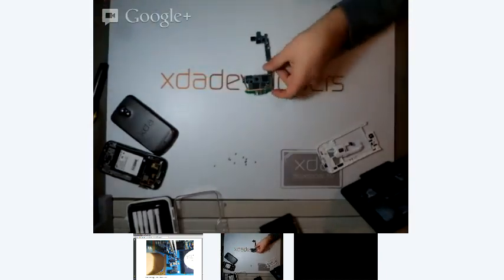All right, so next we need to hook up the Bus Pirate, I guess. The magnet wire, I'm sorry, I got off topic. The magnet wire would actually hook up to a switch, which we could use external to the device, and that would allow us to decide if we want to boot from the internal MMC or the external SD.